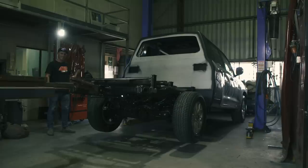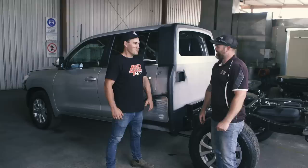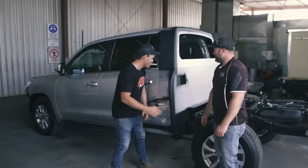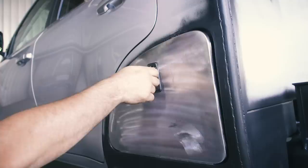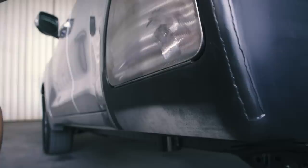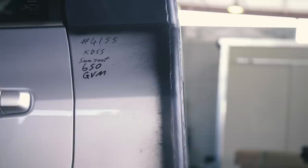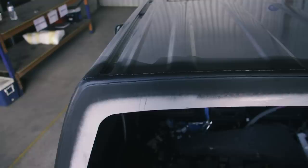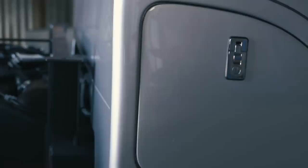Big step in the build — it's come out of the fabrication bay and it's rolling now. It looks like a dual cab 200 — it is a 200 dual cab, this is insane. It's got a rear wall on it. We wanted the shapes and everything to match the dual cabs on the market from brand name manufacturers. We ran a few angles in the faces and really wanted an edge that was ergonomically satisfying. We decided to run the big integrated roll bar in there, which lets the panels weld to it without too much distortion — that's why we don't need too much body filler. There's a lot of steel and not much body filler, unlike a lot of other chops in the market.